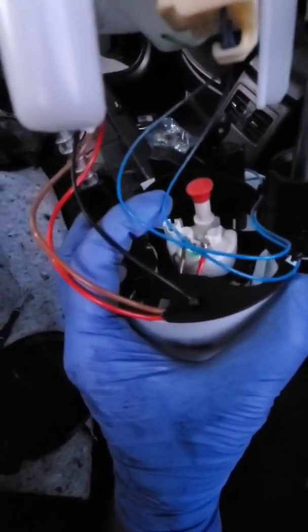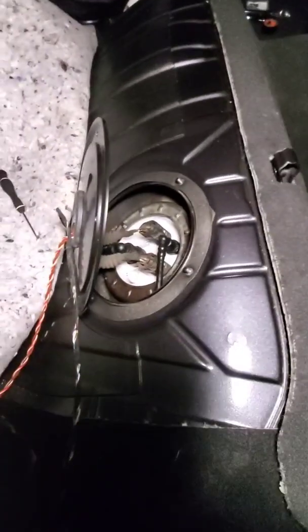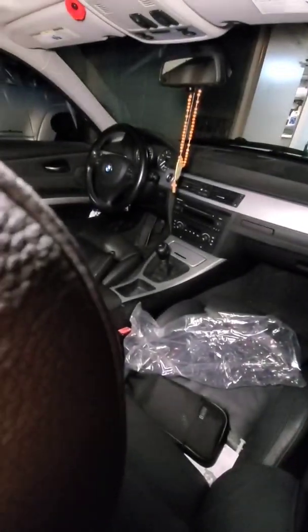So one side done. Now to change out the gasket here. The 2 hoses, they will clip on right here, 1 and 2, followed by the 3rd one that goes on top there, and then 4th one that goes from the bottom right over there. And this cap goes on top, and then we screw it all back on. Right, everything is plugged in, tightened down. Same thing on the fuel pump side, tightened down, plugged in as it should be, or I think it should be. So time to plug the battery back in and give her a start.